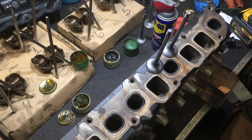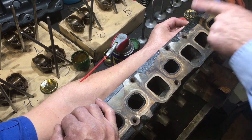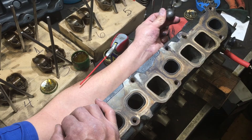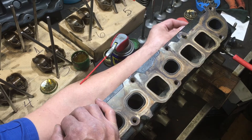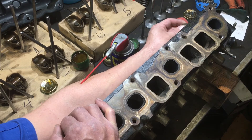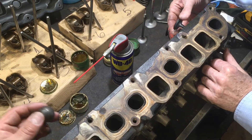This is the old way of doing valve jobs — I'm talking 1940s, 1950s, before machines were actually brought forward. This appears to be working really, really well. I'm going to push the valve out so you can see what's on the backside — we've just got a big steel marble on the backside to put pressure on the valve itself to hold it in place — and then running the drill on low speed. Valve lapping using an electric drill, and so far I think we've got a good process here.